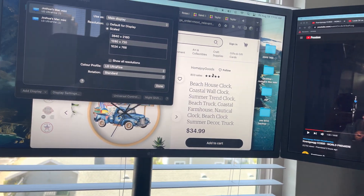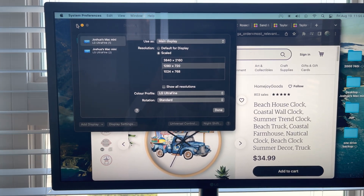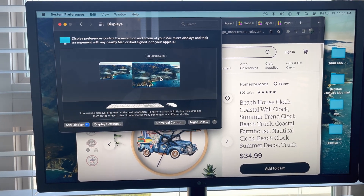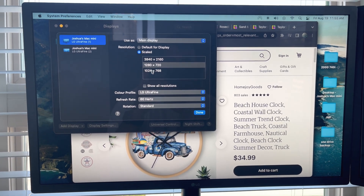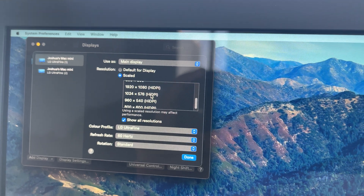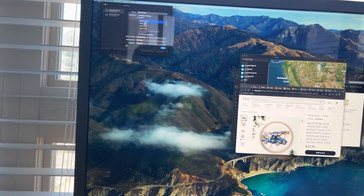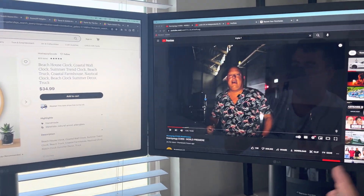When you plug in the second display via the Sig adapter, you'll notice that this is a significantly lower resolution than what you're used to. So what you're going to want to do is bring up System Preferences and go to Displays, then Display Settings. You'll only have three options, but if you go to 4K you'll notice it's pretty much unusable. What you want to do is hit the 'Show all resolutions' checkbox, scroll down to 1920 by 1080 High DPI, and switch that - and now they're both working.